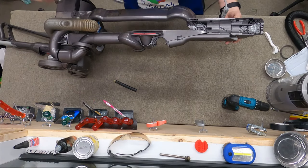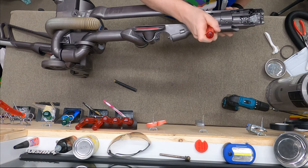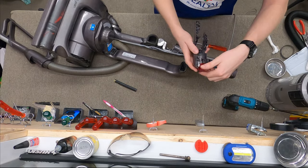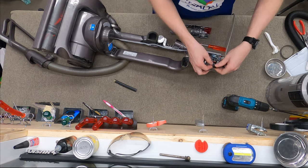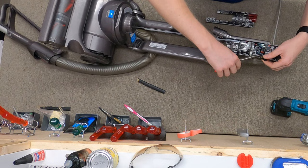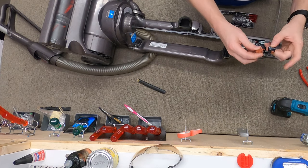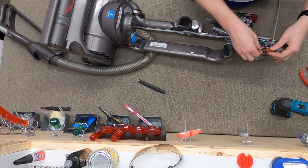When you want to pull the switch off, grab a screwdriver and there are some plastic clips you need to loosen right here. The plastic clips are loose. Be careful because this stuff can all fall out and you'll have a bad day. You can see where that switch has gone bad. You have to release the clips when you squeeze these things. There's the switch — luckily it is a standard switch, so we can just replace it. There's barely enough room to work with in here, so if you get any of these wires out of place they must be put back properly.